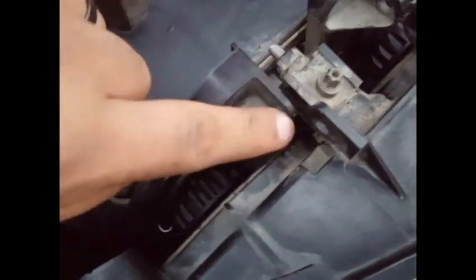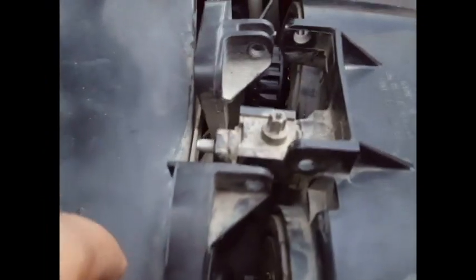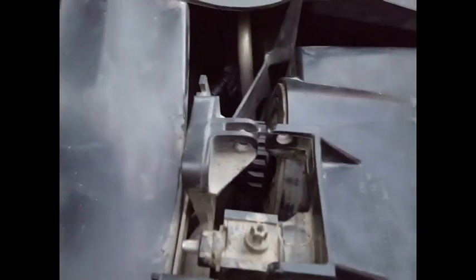Okay, now that everything's clear, try to see about sliding your headlight back in place. And we have an issue. See how this is resting up against the light bracket before these are able to join. You still have about an inch to go. Same with this side. It looks like it's pretty much already maxed out right there. So this is not going to work for this setup. I'm going to have to bring my Dremel out right now and drill out those headlight supports, and we'll see if it'll fit with a little bit of trimming.